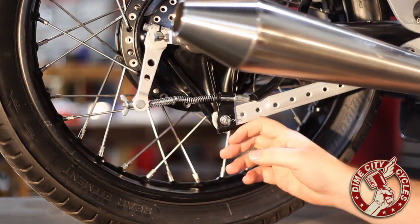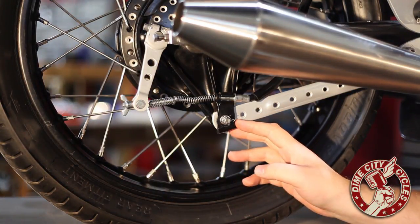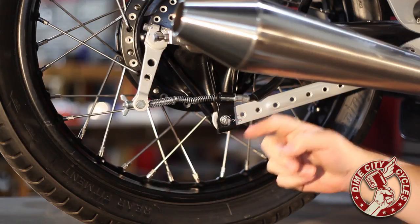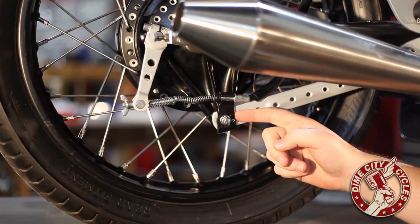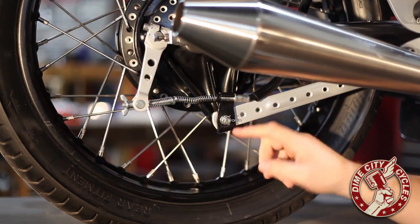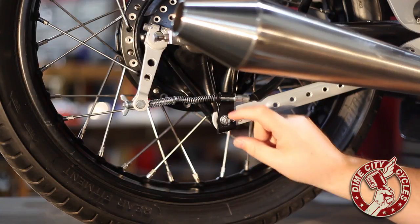For this project, we're going to start by installing the hub bracket onto the hub plate by removing the hitch pin from the nut here and then backing out this bolt. You're going to want to install the hub bracket over this stay here so that the position is such that you can reinstall your hitch or cotter pin when the nut is tightened back down.